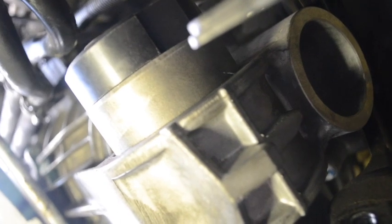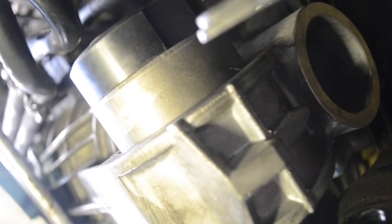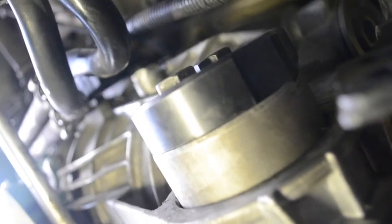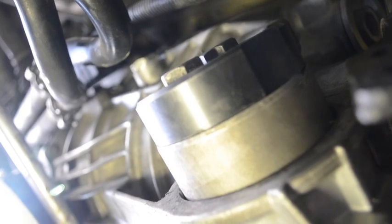Here's the mount halfway installed, coming in from the passenger side which has the taper on the transmission. The factory mount doesn't have a serious taper on either side, so you go with the taper on the yoke of the transmission and go in from that side — it'll pull through. Check that the bolts are vertical by using a bubble level to make sure they are properly aligned.